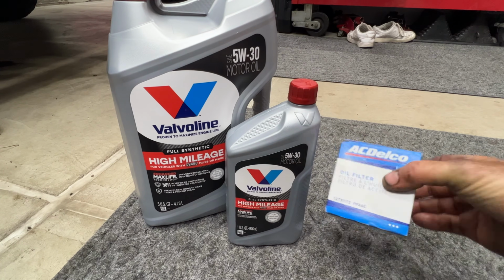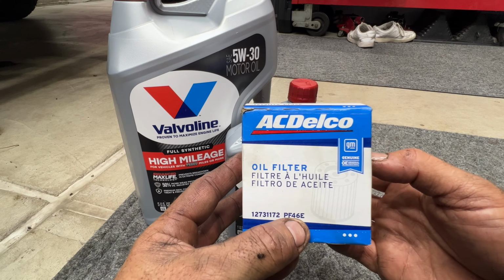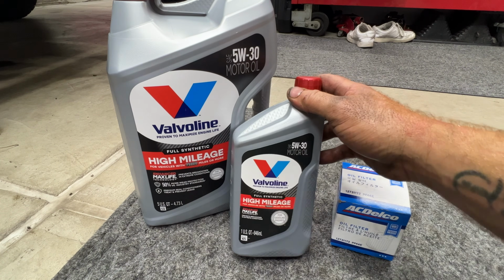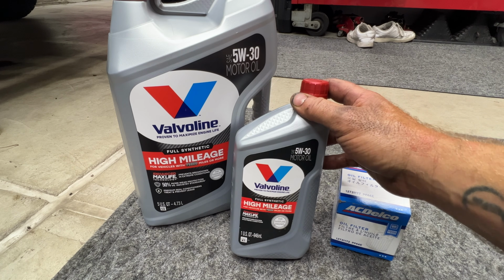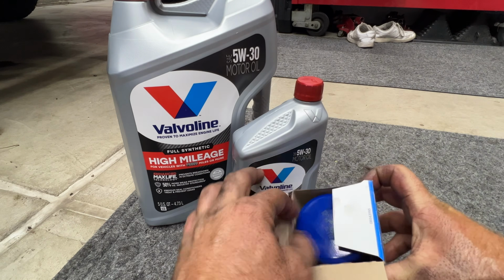Go ahead and grab your new oil filter. Just went with the Genuine AC Delco PF46E. I'll put a link in the description for it. And then I'll be using just some of this Valvoline synthetic high mileage. Got a total of 6 quarts.